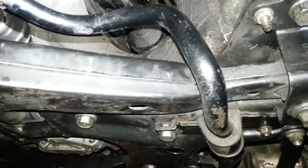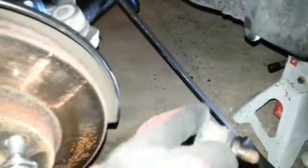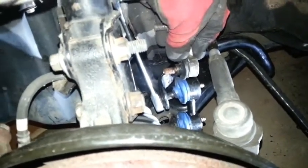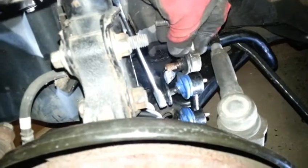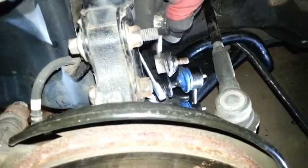Then I will re-tighten that, putting the load back on the system. The old one was skinny, the new one is fat - upgrade yes, proper fit no. This is actually supposed to be installed this way, but the zerks are barely not touching the CV axle, which does have to move a little bit as you turn.